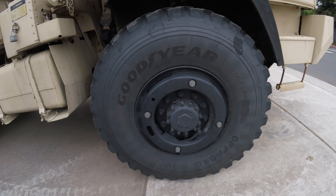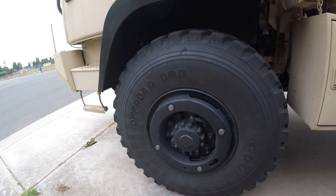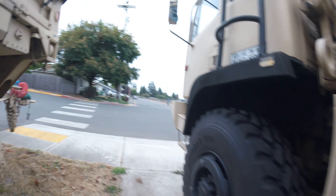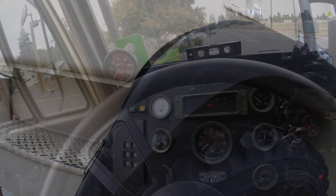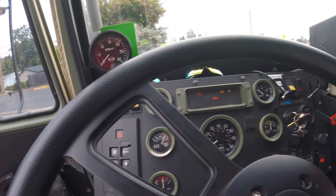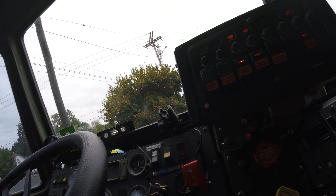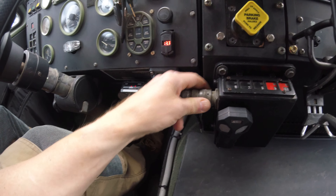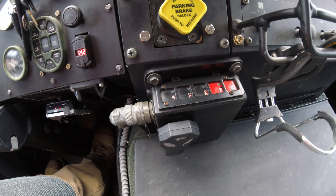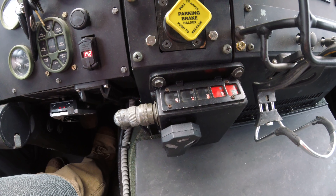Let's go in the truck and I'll show you what's going on, if I can replicate it. On a side note, you can see the tires are not flat — they are completely inflated. We drove back with the CTIS controller disconnected. This one looks low but there's an angle on the driveway that makes it look that way. I just turned the truck on after sitting for a week, and I did not drain the air tanks. You can see everything holds pressure the way it's supposed to.